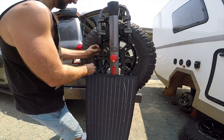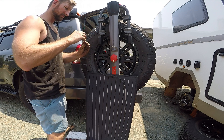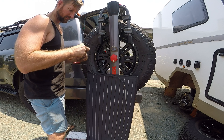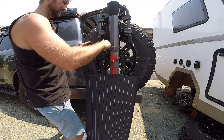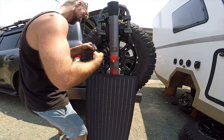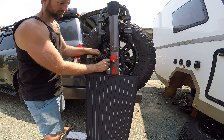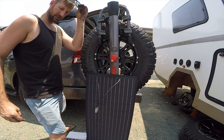I'll put the nose on — the nose is going to go on here. Positive, positive. Click, click, two clicks and then you're on. And that now has power, ready to roll. When I put it on the roof, I'll zip-tie this up nice and make a nice loom. For now, that's the panel ready to go.